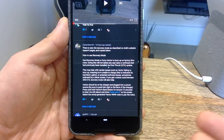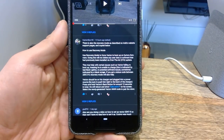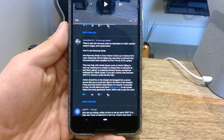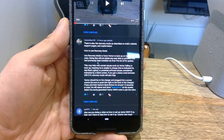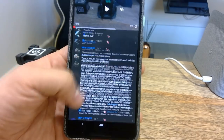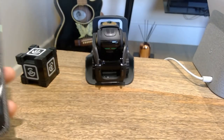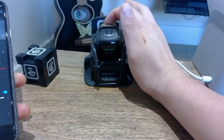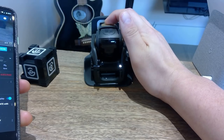Be sure to push him right to the back of the charger to make sure he's charged. Press and hold Vector's back button for around 15 seconds in total, and he will reboot and show anki.com/v on the screen. Select the newly generated Vector code to pair the robot. This is an alternative way to sort out any issues. So here it goes — 15 seconds: 1, 2, 3, 4, 5, 6, 7...